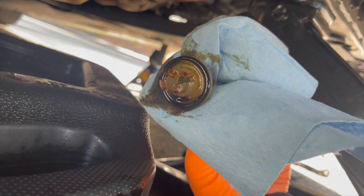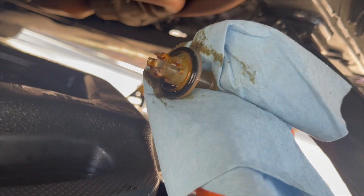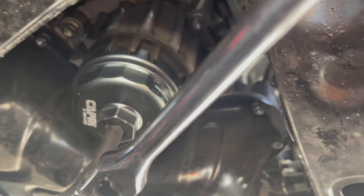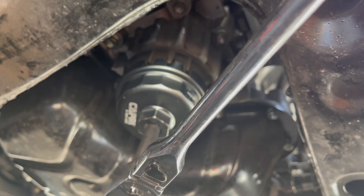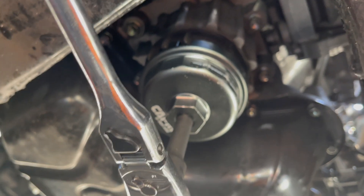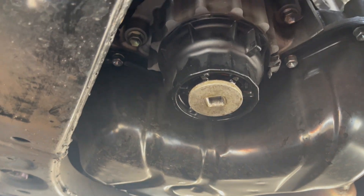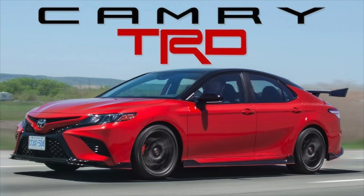Here we have the filter removed and as you can see the gasket came with it — that's a plus. You want to make sure that gasket comes out before you install the new one. So here guys, we are using Toyota's specialty tool by Capri in order to remove our oil filter housing so that we can reinstall a new oil filter in the housing. It was on there pretty tight but we were able to get it. I would like to note that I went ahead and reinstalled the oil filter drain plug back in with the new gasket — I apologize I didn't show that — but I did reinstall the drain plug with the new gasket and got that torqued down before I removed the actual housing.